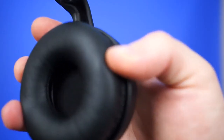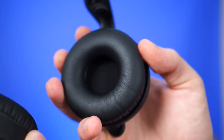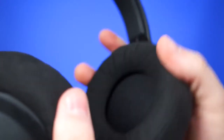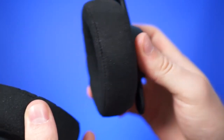That means a lot of the sound you hear feels like it's coming from the center of your head and from directly in front of you. Circumaural ear pads offer more isolation from outside noise and a much wider soundstage. That means it feels like the sound is coming from all around you. The only downside is that they're less practical for wearing outdoors, since they're usually more bulky.